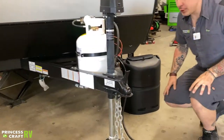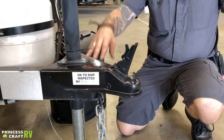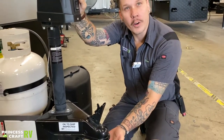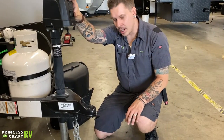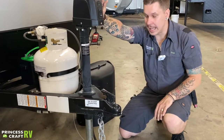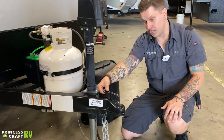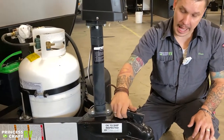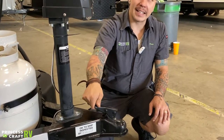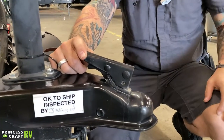The coupling process starts with the coupler in the unlock position. Raise the jack three inches above your ball mount and drop. Center your ball underneath the coupler, then lower the jack on top of the ball. From there, lock the coupler back. What we're looking for is the secondary locking mechanism to be fully engaged. Once you've set it back, give it a pull upward to make sure it's locked on. You do have a pin here — go ahead and pin that for added safety.